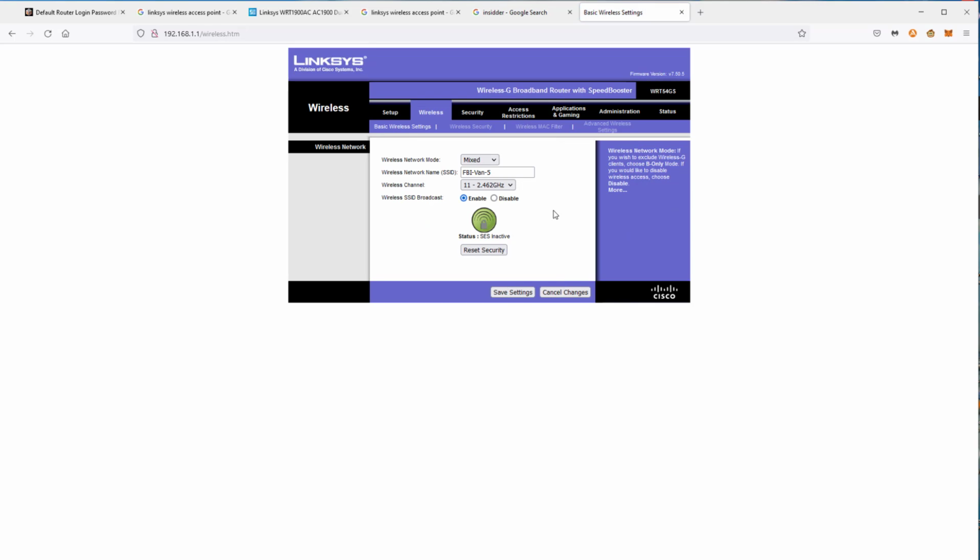All right, but if I hit wireless, now I've got a place here where I can decide which protocols my device supports. And usually they'll support a lot of the backwards compatibility ones. That way, if you've got an older G protocol Roku device, you can still connect to it. So this one is old. It only has the B and G. When wireless first came out, the two big standards were like A and B. So when you see A and B supported, you know that's an old device. And then everything kind of went to G. A had speed, but B had range, and then G kind of combined both of those. And that's really, once G came out, that's when wireless really kind of blew up.